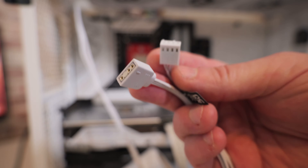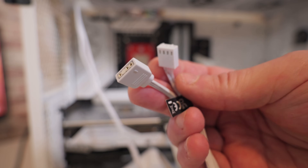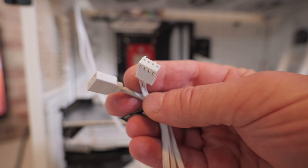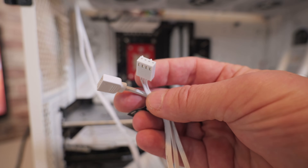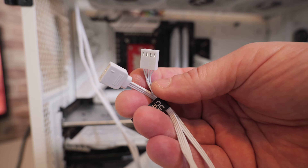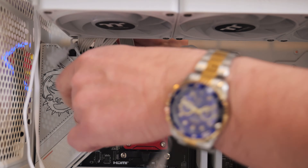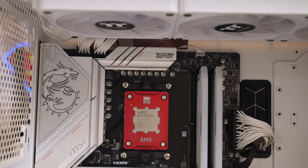For the fans on the radiator, all you need to connect up is a 3-pin 5V addressable RGB on the left, and also a 4-pin PWM signal. The 4-pin PWM signal attached to the fans — you need to connect that to the motherboard header called CPU fan. Don't connect this to the one that says AIO pump, because you'll get the speeds wrong and they'll just be hard to set up. So the PWM one that connects to the fans always goes to the CPU fan header. I'm going to route the cables through to the back and then pass them back through again to keep it tidy. I'd suggest leaving a little bit of slack just in case you need to do any movement.